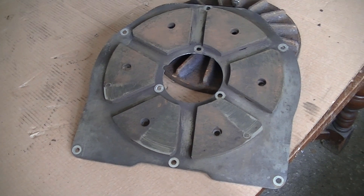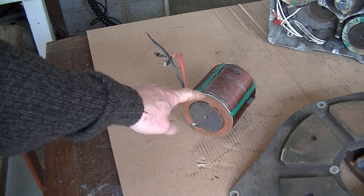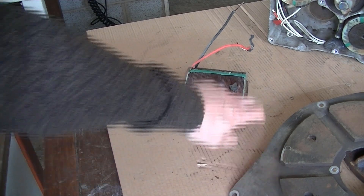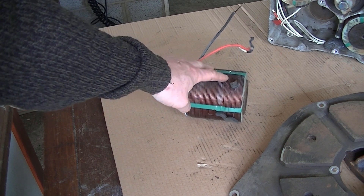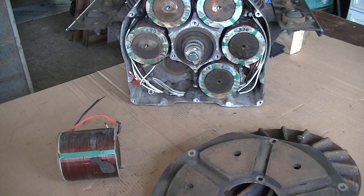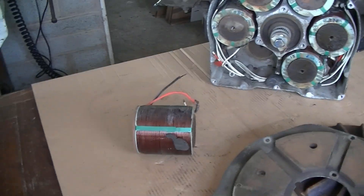There's the coil — it's all heavy, every bit of it. That weighs a good few pounds on its own. It's got a rubber or foam washer at one end to cushion it, but the coil itself is trapped between the two shoe plates on both sides and bolted up. It has very heavy duty winding — looks like aluminium — they're crimped, you can't solder it. It's held in place with large blobs of black silicone goo, which you can see everywhere inside. Once it's bolted between the two plates it's not going anywhere, but it's very well constructed.